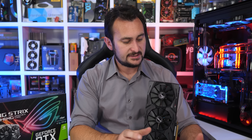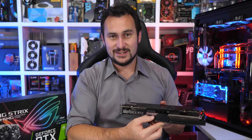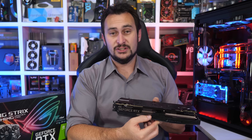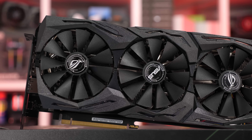At least in this case you can clearly see where the extra money is going. Whereas the $350 models are little dual and single fan cards, this beast has three — but really it is more than that. This RTX 2060 has a high-end cooler. It's a two-and-a-half slot design, so it takes up three slots, but this means it offers 40% more fin density than the dual slot versions. You could easily mistake this thing for an RTX 2080Ti. It's long, it's tall, and it's thick.